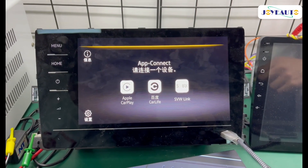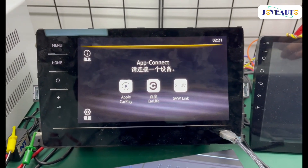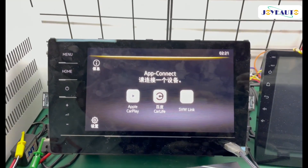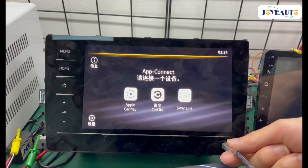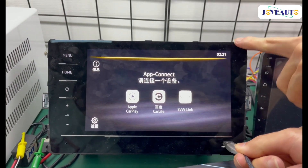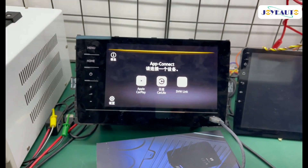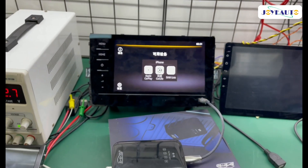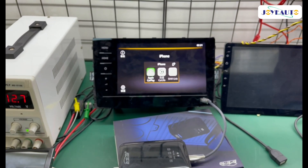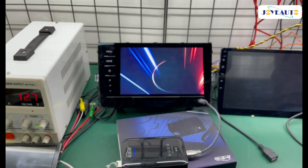Normally after around 10 minutes the system will return back to the Android 11 main menu. But if it doesn't and the LED is still red, you can unplug the USB, then plug it back in and wait around 10 seconds — the system will appear. Only do this if the LED is still red after around 10 to 15 minutes; just re-plug it once and the system will show again.